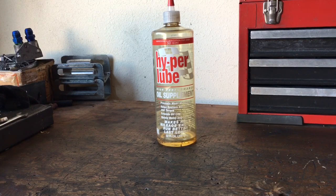had to have the cylinder head redone because the previous owner had blown the head gasket and it needed to be surfaced. When they surface the head on that particular model engine, you're supposed to change the shims for what I refer to as lifter buckets. They're not a regular lifter or follower like you would think with a Honda or a Ford motor. It's actually like a bucket that acts as a lifter.